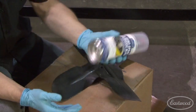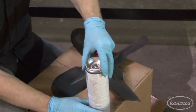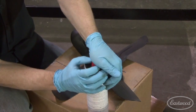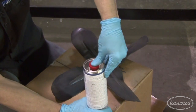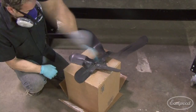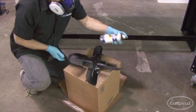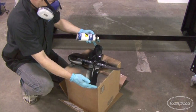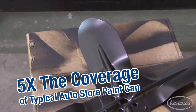Using it is very easy. Shake it — make sure everything is agitated. Then pop the button out of the top of the cap. Place the can upside down on a relatively firm surface and simply place the button on the little peg at the bottom of the can. Using the heel of your hand is best. You can hear a distinct sound when it breaks the membrane and releases the catalyst into the rest of the can. Then shake it up for about two minutes. The Advanced Design Air Cap atomizes the paint beautifully and allows you to use the same 50% overlap that you normally would with a pneumatic spray gun. The distance from the work piece is about six to eight inches. One of the major differences between this and any other rattle can is the shape of the spray pattern — it's the perfect elliptical pattern that you would have with a normal expensive spray gun.